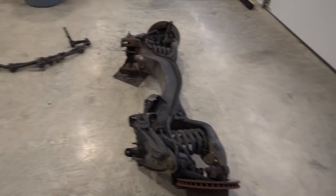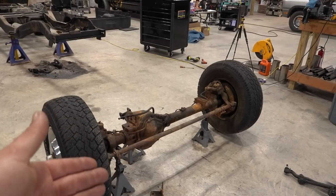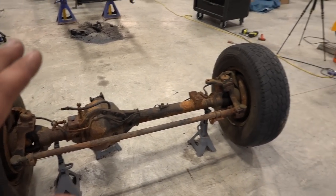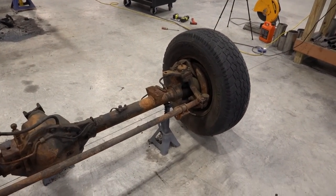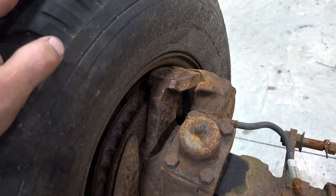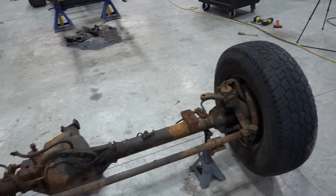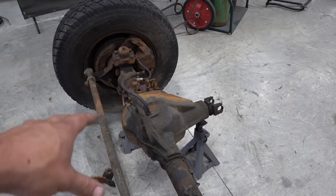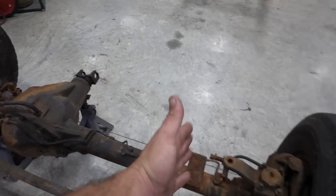That's what counts. And here you can see we brought in our, I don't know if I'd consider this brand new, it's a little more on the used than brand new part, front axle, but it needs cleaned up. It does need some love. One big thing that makes this axle really a big pain in the butt is that it was sitting for quite a while. The brakes on this one are locked up really bad. So we need to get this thing to actually be able to roll, because right now the wheels do not spin freely. You guys can see on the first gen front axle, on the four-wheel drive axles, the pumpkin is on the passenger side, which is different from all of the third gens, which are normally here.